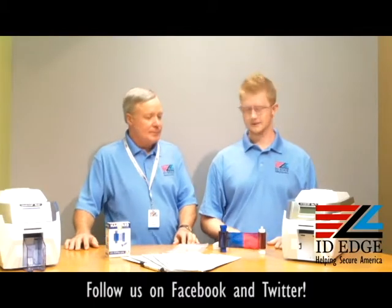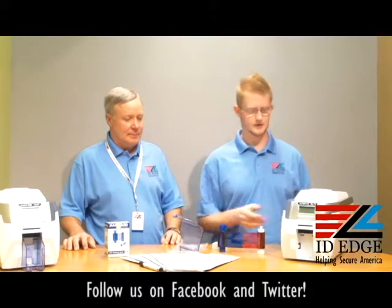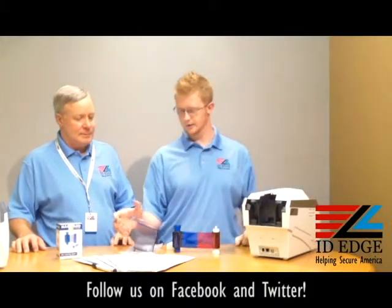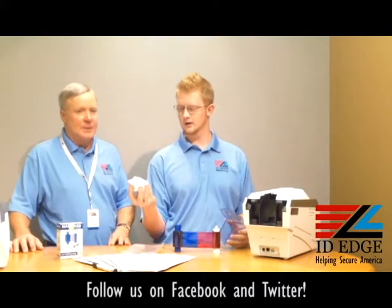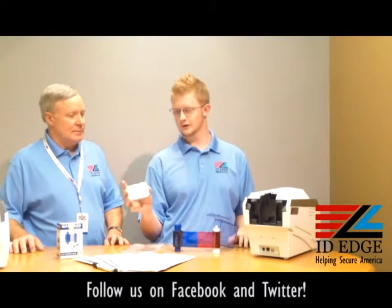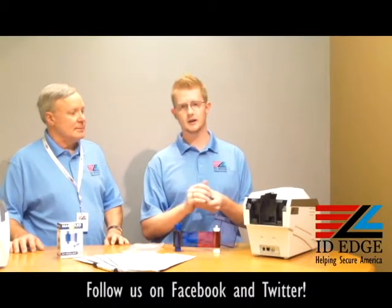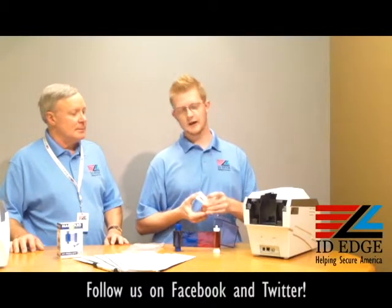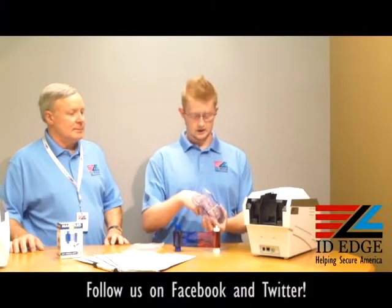What we're going to do is grab our card hopper off the back of the printer. I'm going to spin this around for you — so this is the back of the Magicard Rio Pro. We're going to load our standard CR80 PVC 30 mil cards. A little trick to prevent them from sticking together and causing card jams: just fan the edges of the cards on both sides. That prevents static buildup and helps the cards feed into the printer nicely.